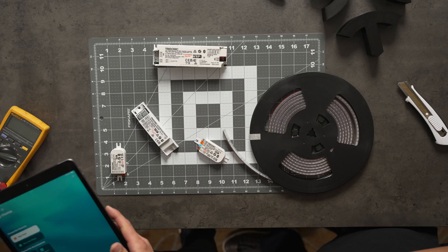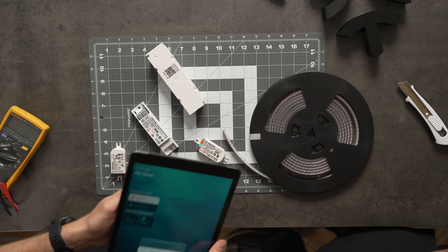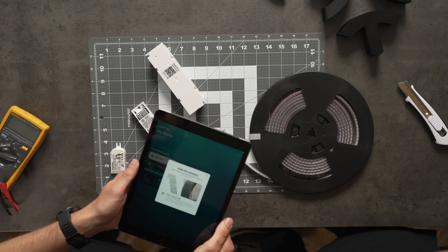Can you show us how easy it is to set up a device in Matter? Sure. Whichever Matter ecosystem you use, it's all done in the same way. We have our products here on the backside — you can find the QR code. What you need to do is just open the app. We have Apple Home here as an example. Just open it, add accessory, scan the QR code, and then it just needs a few seconds and it's onboarded.